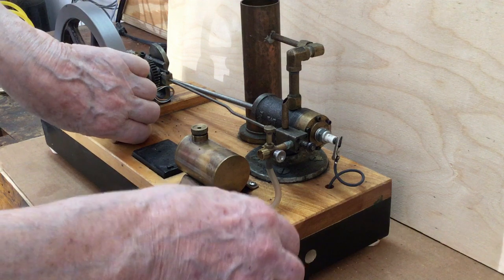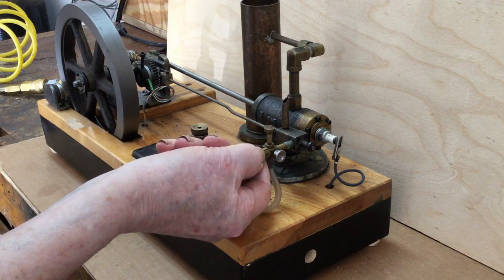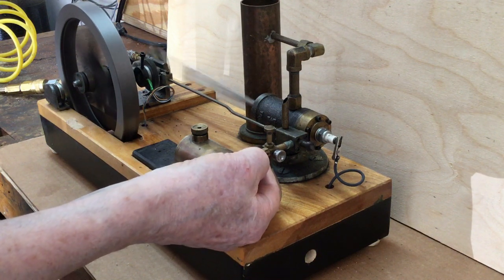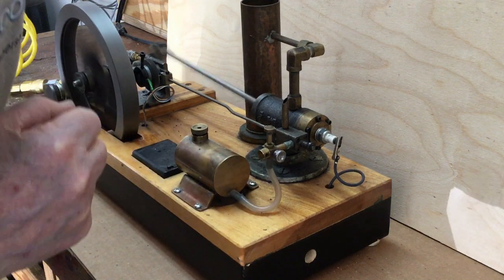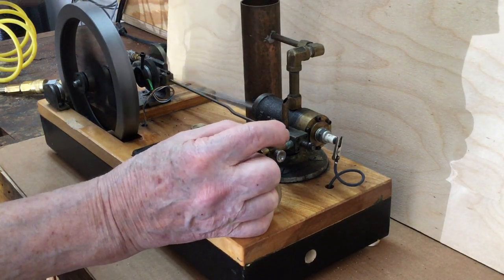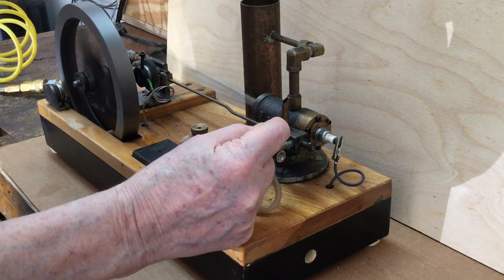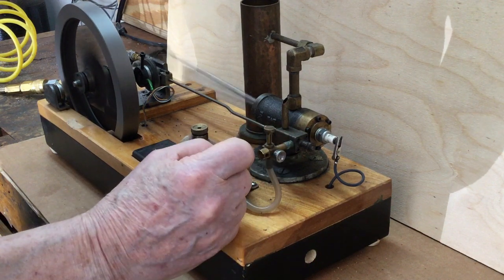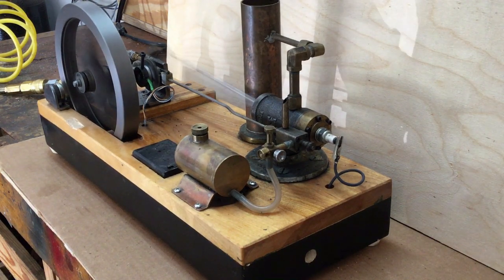The engine is a little finicky and sometimes it takes a few turns to start. We're getting a little smoke out of here, so we're going to turn the choke to partially uncover that hole. Opening up the choke a little bit more — this engine wasn't totally cold so the mixture didn't need to stay rich for very long. Now I'm going to adjust the needle valve because you can hear it's misfiring. I'm starting to close the needle valve by turning it clockwise very slowly, listening to see if it starts hitting more regularly and speeding up. Now it's at about seven-eighths of a turn open, approaching three-quarters, and right at three-quarters is the setting it likes to run best at.